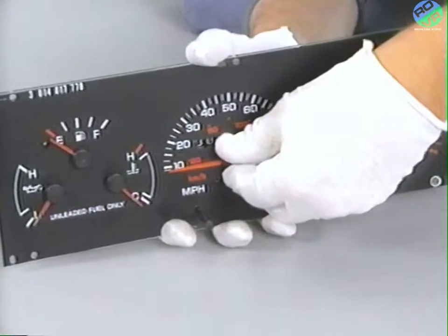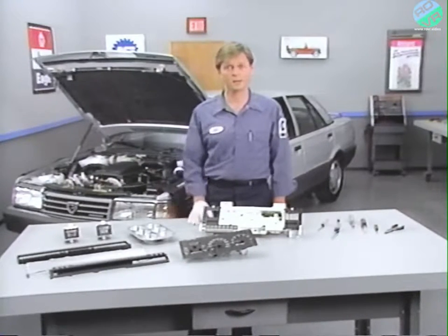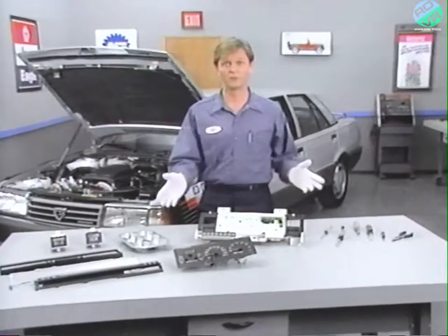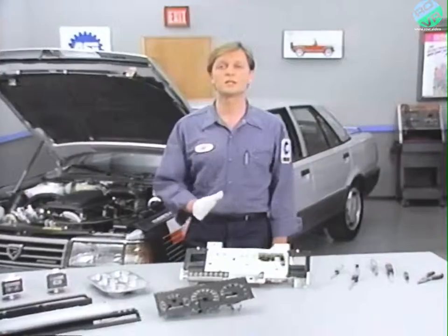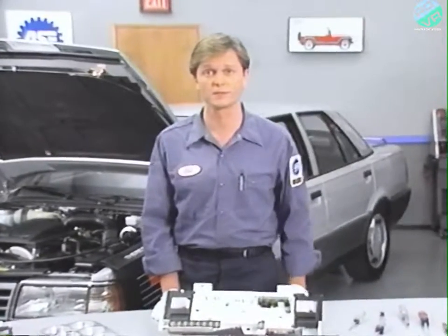as for the tachometer. If the pointer is not properly aligned to the horizontal graduation, perform the same adjustment procedure used on the tachometer. After installing the speedometer and tachometer on the new dial and gauge assembly, reverse the removal procedure to install the dial and gauge assembly into the cluster housing. Then install the cluster housing into the vehicle, making sure that all the screws are returned to their original positions.